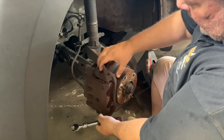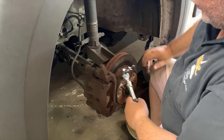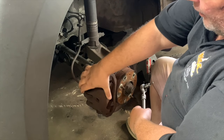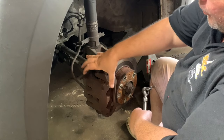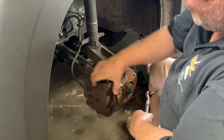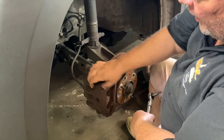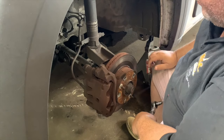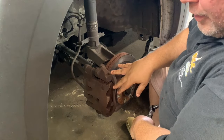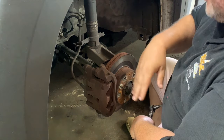This piece is the caliper itself, and this piece is the bracket that holds it and guides it as it clamps over the wheel. The important thing to know about the slides we're going to be lubricating is that as the pads wear — picture this in your mind — if this is squeezing, it needs to squeeze evenly on both sides of the brake rotor. To do that, it needs to be able to slide back and forth so that the force automatically centers it. If this was rigid, it wouldn't squeeze evenly. I should also mention that when I do brake jobs on my vans, because we've used a ton of anti-seize on everything previously, this stuff comes apart super easy.